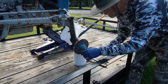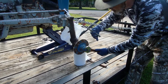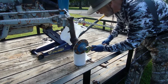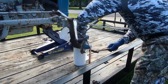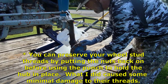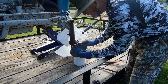Okay, pull this up out of the way. You put this on so that you can loosen this thing, and I can't loosen it, but here's a little trick. You take some kind of a bar or your punch right here, put on your adjustable wrench. I keep wanting to call it a crescent wrench because that's a brand name. Whack it with a hammer to try and break it loose. There we go. You can break it loose that way. I like these caps that screw on instead of hammer in because they don't come off. You don't lose them. All right, get this dust cap off.